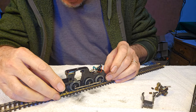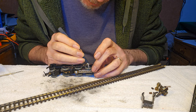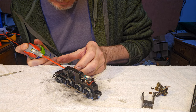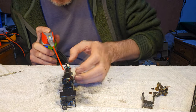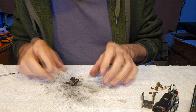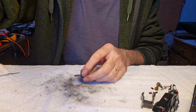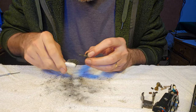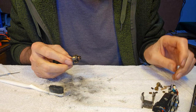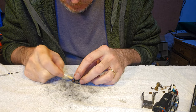Let's just see how free-moving these wheels are. That's fine. This came packed in polystyrene so it's got little bits stuck in the spokes as usual. Make sure we get these brush shafts clean. Give the armature a clean up. Get the monkey brush onto this. It's the locking nut for the bearing. We'll get the commutator cleaned up — give it a scoop first. Get the old T-cut in the commutator.